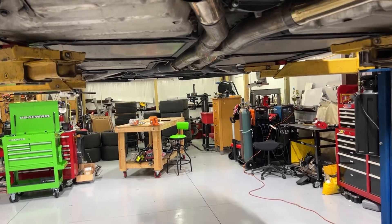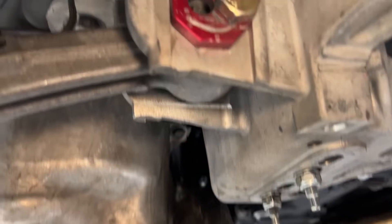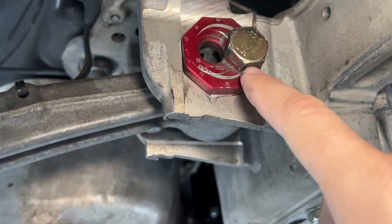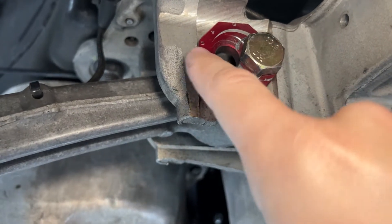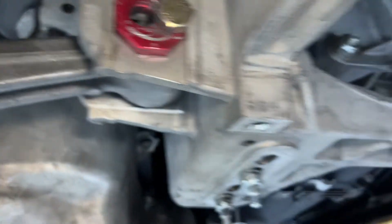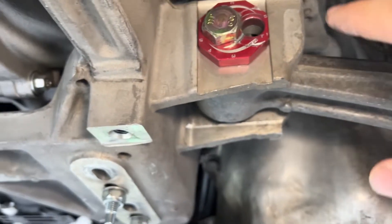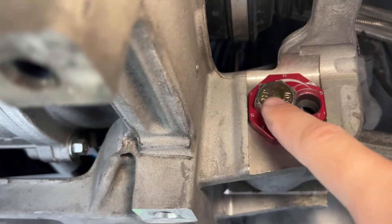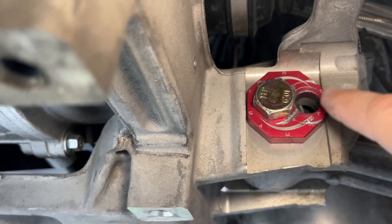Getting under the car, we check what we are on. This one is set to T5 — we know that because T is covered and 5 is here. On the other side, we are already staggered a little bit, and it's on S5 because the S is covered and T is not. So we're on T5 and S5, and that's what's giving us our current settings.